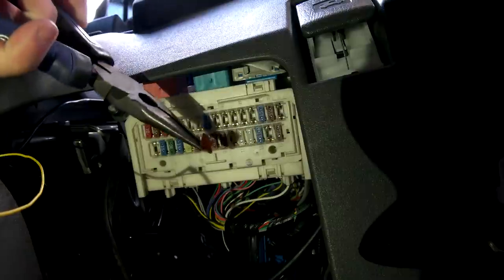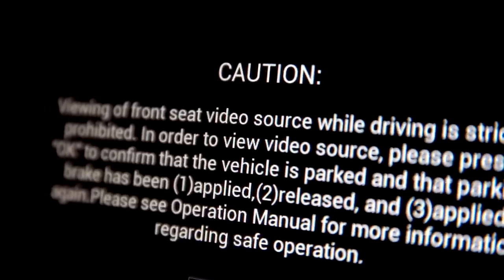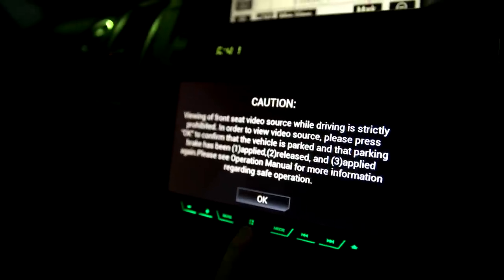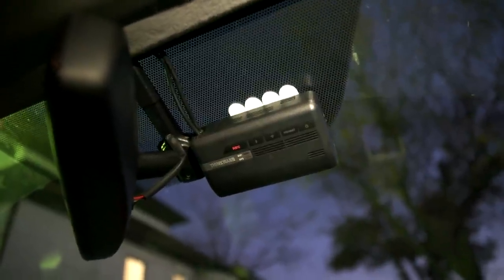Another problem is I blew a fuse. So if you don't want to disconnect the 12 volt battery and reinitialize everything, you may want to have some extras on hand — I got about a hundred for five bucks from China. I also had a problem where my parking brake bypass still wasn't letting me watch movies on my stereo. This was because I connected the yellow wire to my wiring harness, which I believe was meant for just the braking pedal — but most bypasses out there don't even have this yellow wire, so I just disconnected it and then it worked fine. I hope you guys found this video helpful. I'm also planning on making a tutorial on how to hardwire in a dash cam so it'll record in parking mode even while the car is off. Thank you guys for watching — see ya!